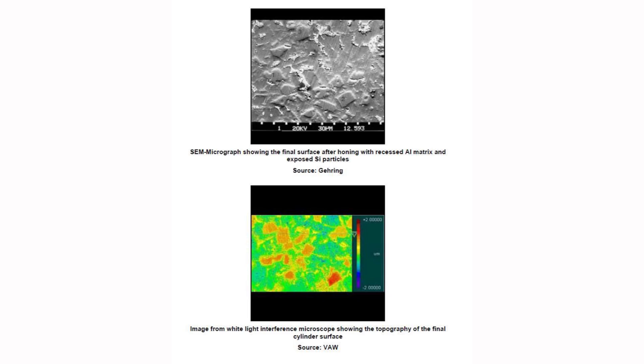FerroPrint was designed for use with aluminum silicon cylinders, such as Alusil and Locosil, along with MMC and FRM bores. These cylinder surfaces differ from conventional cast iron and steel because the running surface of the cylinder is composed of exposed fibers and crystals with an aluminum base.